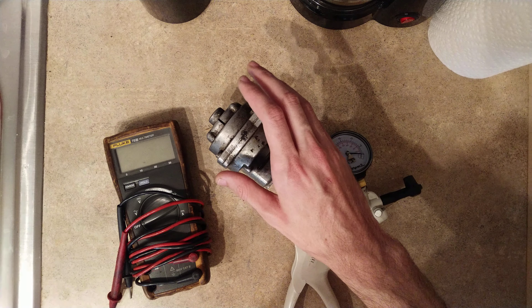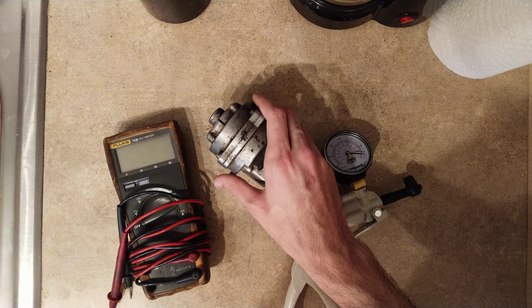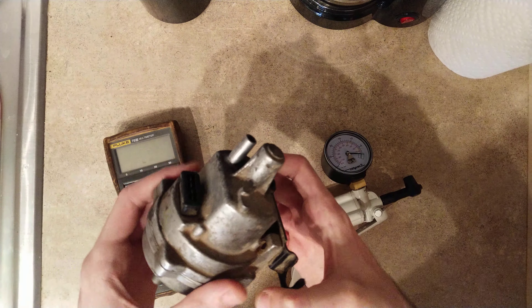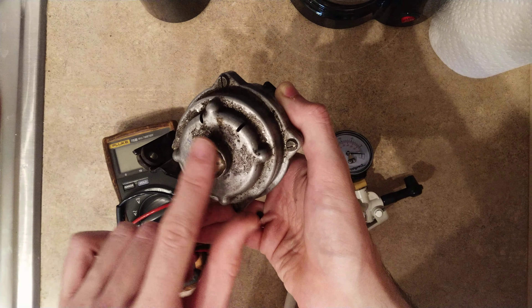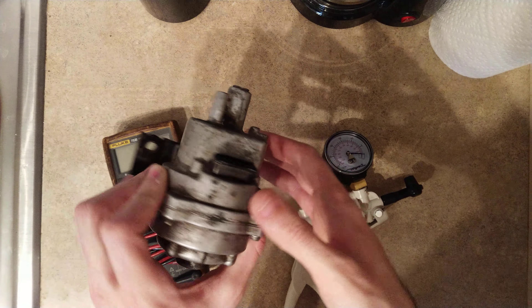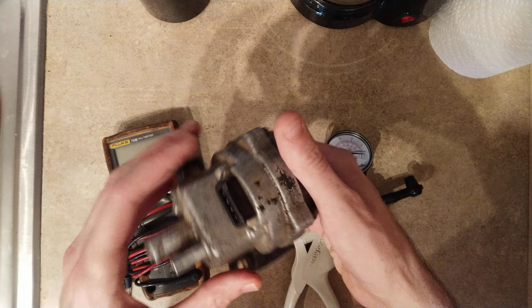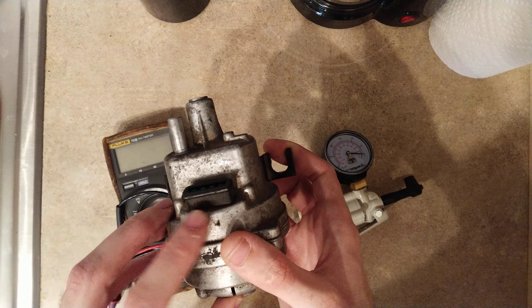In this video we're going to check how to diagnose your Bosch D-Jetronic MAP sensor or pressure sensor, to see if it's working and in good condition. You want to check the adjustment screw in the back — this one is still potted in and sealed, it hasn't been tampered with. Overall it looks to be in good condition, it's a little dirty. This sensor we're working on today ends in part number 051C.